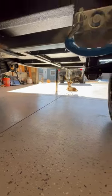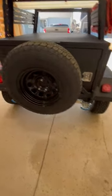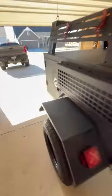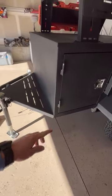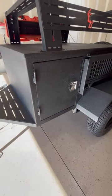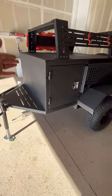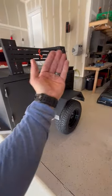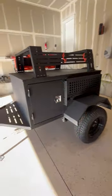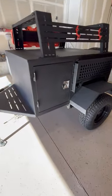We also have a lot of conduit under there, because a big thing I see a lot of people doing is adding extra electrical. I'll show you inside the trailer what I did for the electrical portion. Under the trailer you have a tongue box with a battery pack, and it's going to be exceptionally easy for you to port under the trailer and distribute wiring and power pretty much anywhere. There will also be conduit inside each main pillar — so if you come up through the corner you can easily run up the pillar — and there will be conduit up on the roof as well, so you can distribute wiring to anywhere within the trailer for lighting, etc.